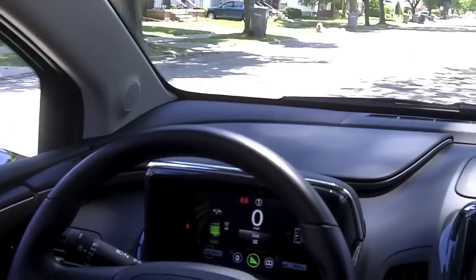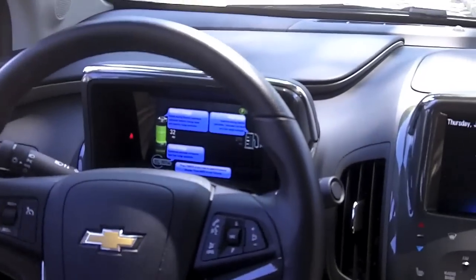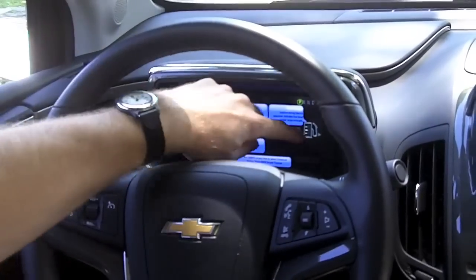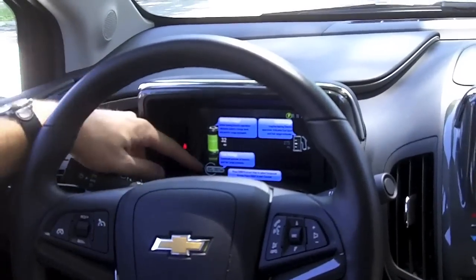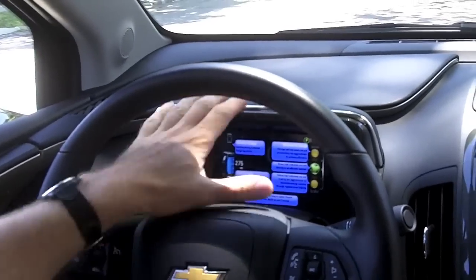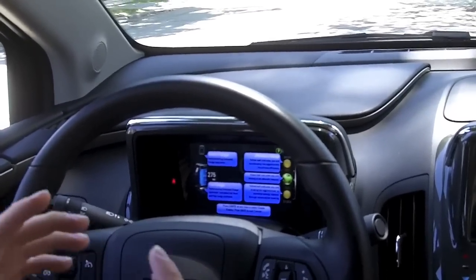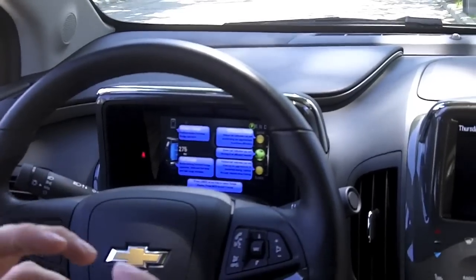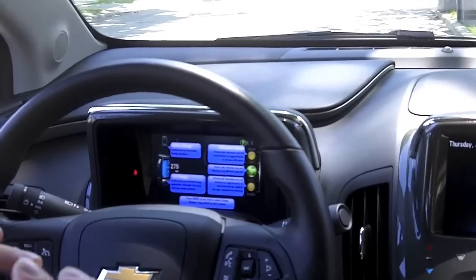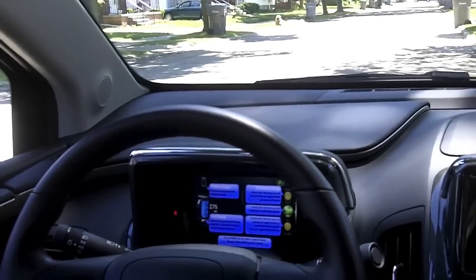You can change between miles and kilometers, and there's a tutorial mode. In tutorial mode, hitting select brings up a demo screen that shows all-electric range and range-extended mode regardless of energy left, with an estimated cumulative range in the lower left corner. Hitting config brings up an alternate configurable display with an efficiency gauge on the right — a green leaf ball you want to keep centered at all times for optimal efficiency. Accelerating too hard makes it go up, get smaller, and turn yellow; braking too hard makes it go down and turn yellow.